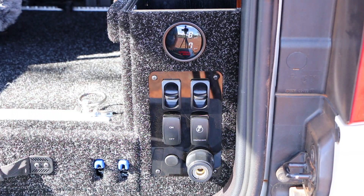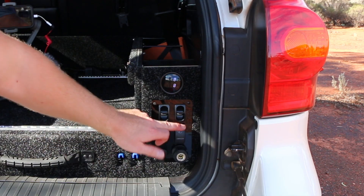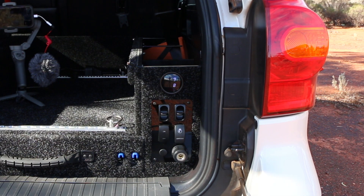Let's start the car up and get this air compressor turned on. Now that the car is on, we'll simply hit that switch. When you turn the compressor on it's going to prime that air tank. Now we have 150 psi primed up in all lines and in that 4 litre air tank.